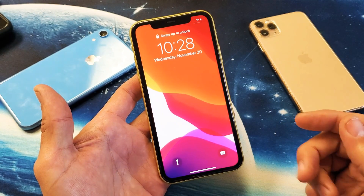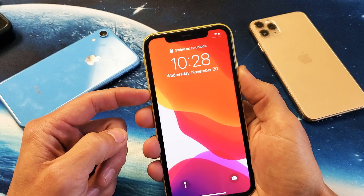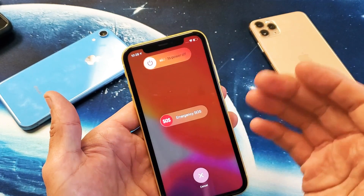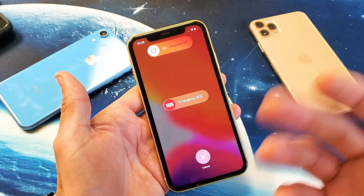Typically what you want to do to fix this is simply turn off your phone and turn it back on. Press the volume down and the power button, hold, wait for the power off menu, and boot it back up. The thing is, that only fixes the camera lagginess about 50% of the time.